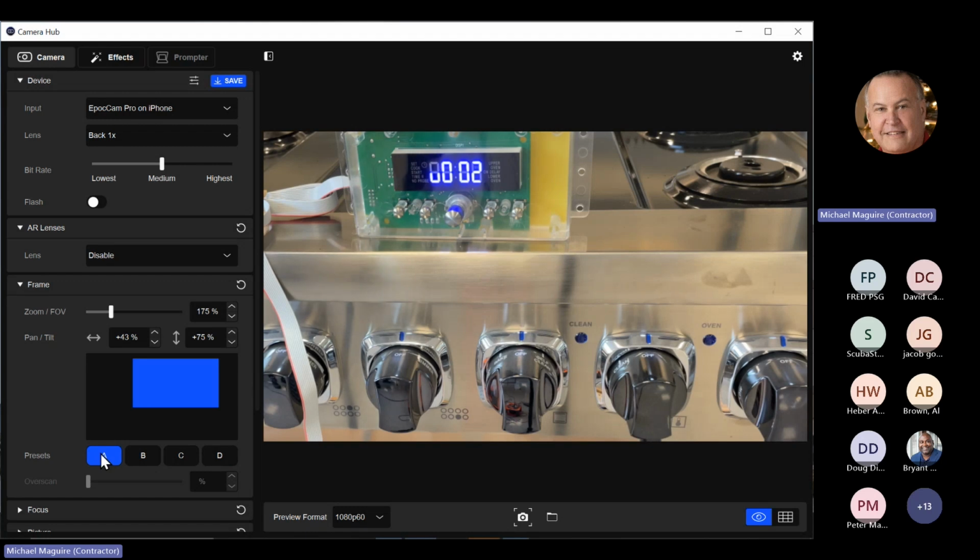One thing I will point out, anybody that has done this before, the boards came with amperage sensors built in. So when we checked the heating elements on the wall oven that I ran yesterday, you could see what the amperage was on each element. I just discovered today that this range no longer has the amperage sensors. So you can operate the elements, you can hear the relays click, but you're not going to see an amperage reading. Unfortunately, you'll have to do it the old-fashioned way with an amp probe on this. Again, I just found this out that they removed the amperage sensors on it.